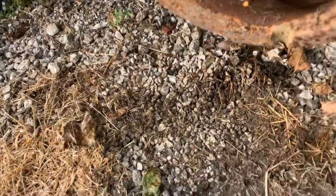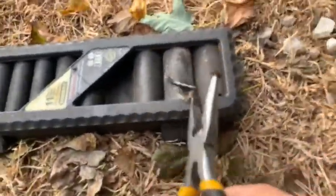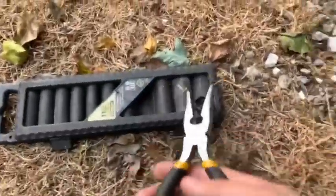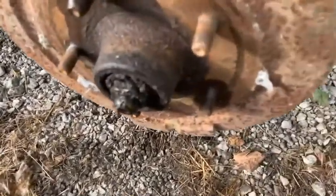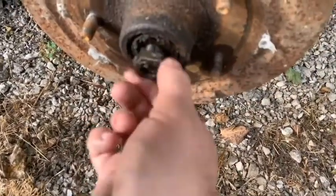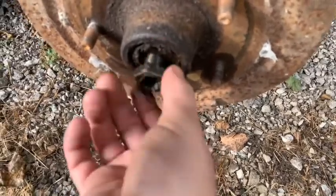I will be hooking up the rear brake line hose, and I'll be hooking it up to the old wheel cylinders to see if they have any life left in them, because I don't have any right now anyways. And they were running without a cap for a while. They're all crusty. And these were really loose, so I don't know if they were just put on half butted by somebody, or if the grease disappeared making that space or what, but they were wobbly.